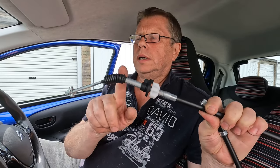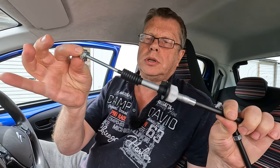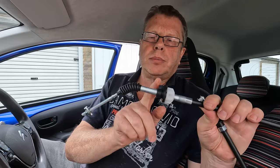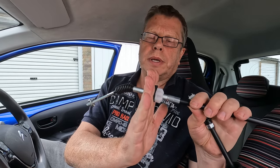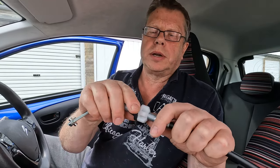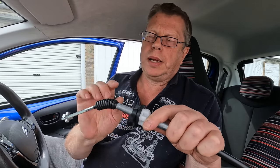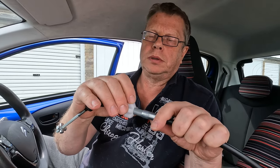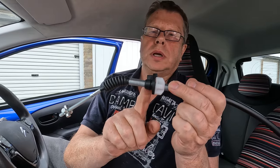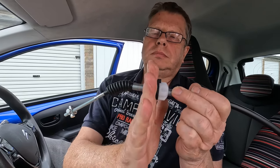This is the end of the clutch cable on top of the gearbox - this engages with the clutch release lever. This plastic nut here controls the position of the cable outer against a bracket. There's a bracket on top of the gearbox and as we rotate this white plastic fluted nut we'll be moving the cable in and out - basically the same kind of arrangement as brake cables on a bike.